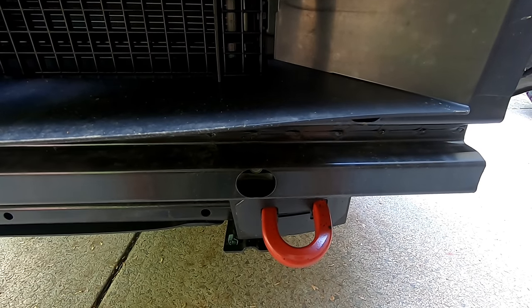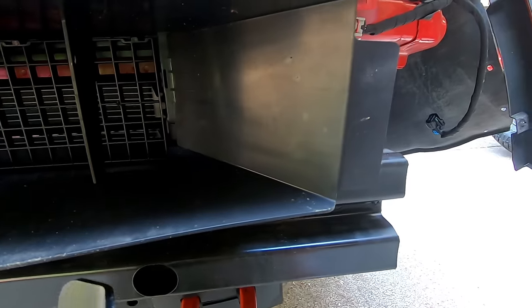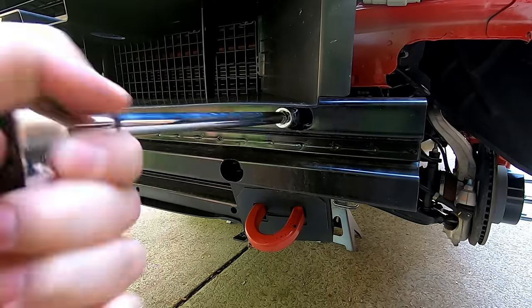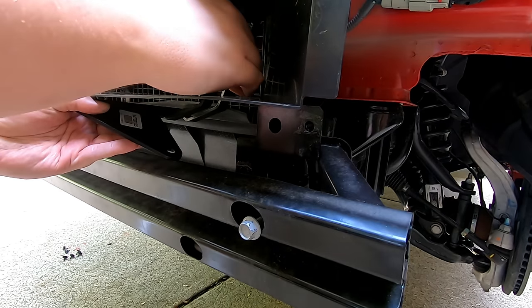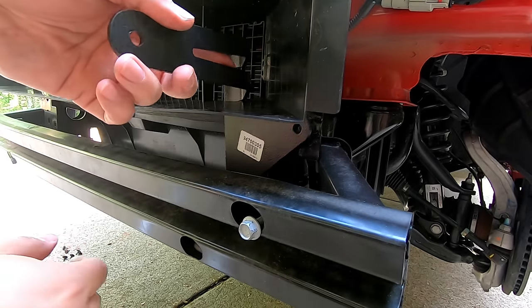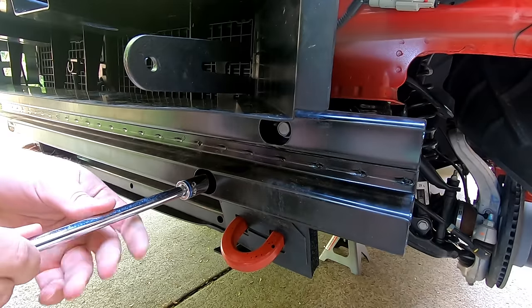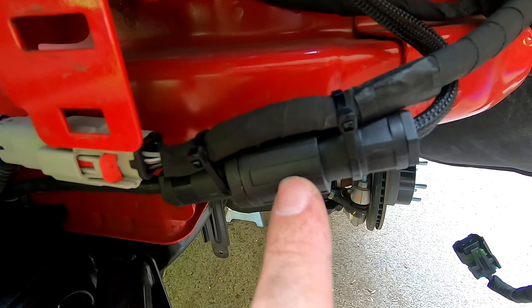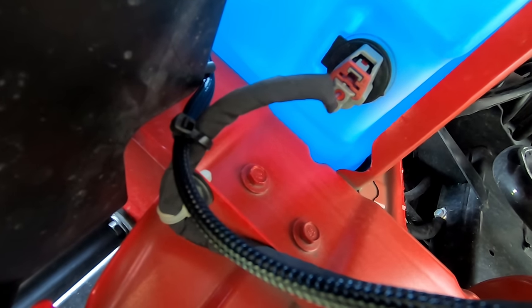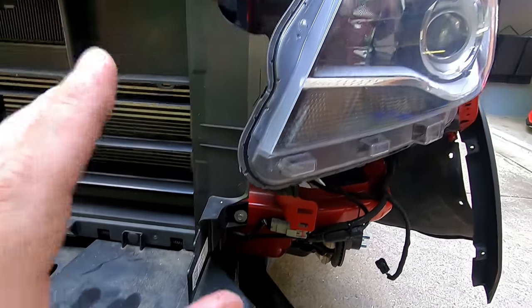To install the hidden bumper mounts for the light bar, we're going to remove these two 15mm bolts holding the crash bar on. You'll basically remove those, slip the actual bracket in behind it, and then bolt them back down. Just like that — those holes line up. Now we just bolt the crash bar back on. So I ran the wiring for the light bar back through here, out right there, zip-tied it to some factory wiring. This is the additional harness for the light bar, zip-tied up to the windshield washer fluid motor wire, then run up through the engine bay to the battery where we're going to ultimately need to connect it. For now, we can go ahead and put the bumper on and then finish up the wiring for the light bar.